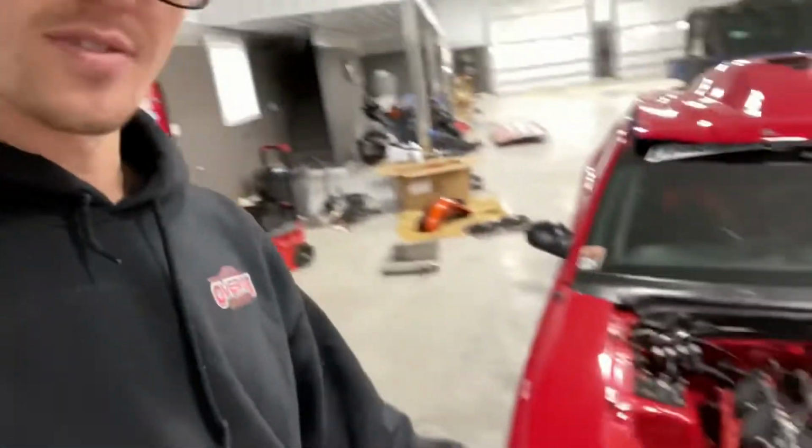And those China valve covers are pot metal basically, so it welds just horrible. When I welded them brackets on, it sucked, took forever. It's not fun. I'm not a pro, so maybe some of you out there can do it better than me, but I struggled with it, so I'm probably not gonna attempt it again. Other than that, I'm pretty happy with it. Changes coming, like I said, the 417 manifold, plus I'm also gonna run my coolant pressure sensor up there since it does not work very good in the back of the head.